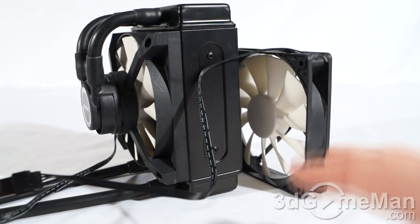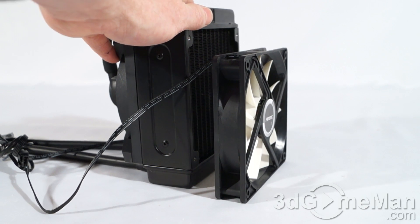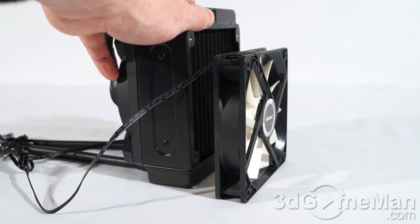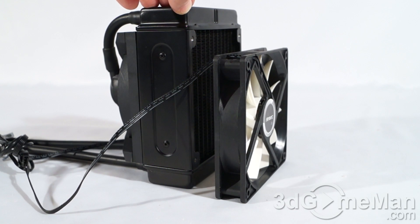You just have to make the power connection and everything is good to go, then mount it to the case. If you want performance, go ahead and install the included 120mm fan — you're paying for it so why not, unless you don't have enough room. The fan is designed to blow warm air out of the case, so make sure case cooling is substantial because it has to draw cool air from inside the case — if the case is warm inside, that's not going to work very well.